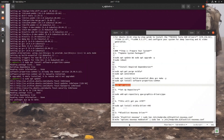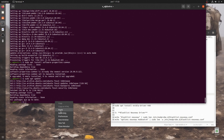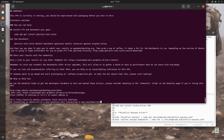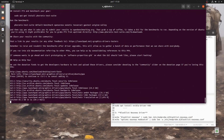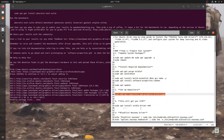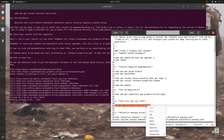Step 3: set up the repository. Step 4: for Kepler architecture — the K80 — use NVIDIA 440 series drivers.